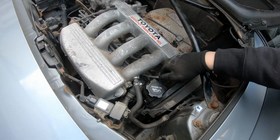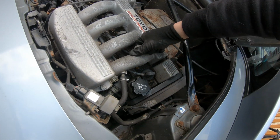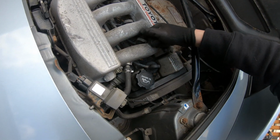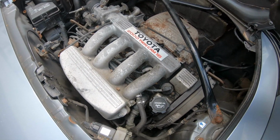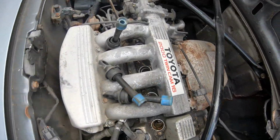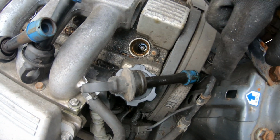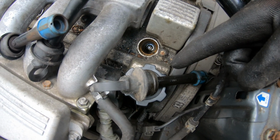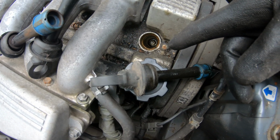So now it's time to pull all these out, like I saw me do earlier. Oh, that was tight. Maybe with 2 hands, and we'll get these spark plugs changed. Crikey me. So earlier I thought that we might have had a rocker cover gasket leak because there's a little bit of oil around there. But thinking about it, someone could have been a bit sloppy once topping their oil up, and it's dribbled down into there, because they didn't a lot at all.